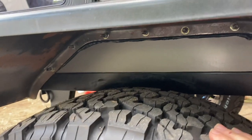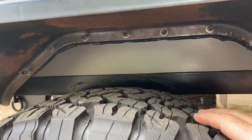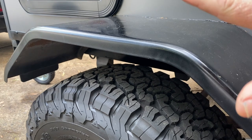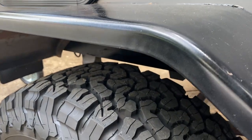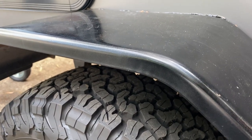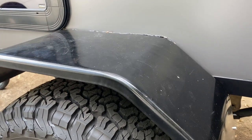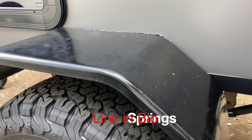With the altered spring packs, the camper has been raised by probably an inch, inch and a half. But the main thing is that with the original spring pack if I rocked the camper it would rock and keep rocking. With this altered spring pack it rocks but stops as soon as I stop rocking the camper. That'll be good for stability — I'm really chuffed with that. It's been a fairly low cost option; $100 for two complete springs which I've separated.